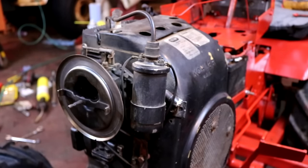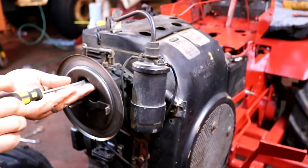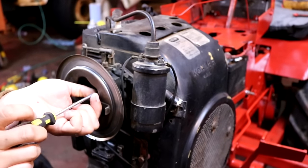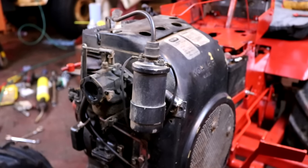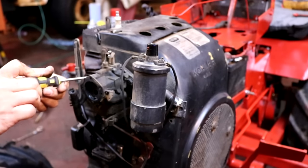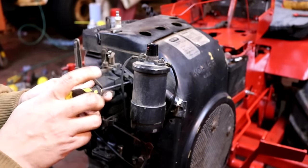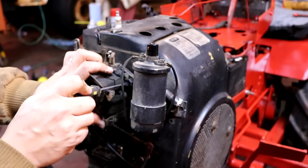I've done this off-camera. Then you remove the air filter cover, the air filter itself, the rear air filter mount — this mount is just held on with three 10-32 screws. Simply remove those, then you can remove the plate. And then you'll remove the throttle linkage that connects the throttle of the carburetor to the governor arm. Then you simply unbolt the carburetor. Due to the tight space, it's best to alternate between the left and right bolt until it works its way out.